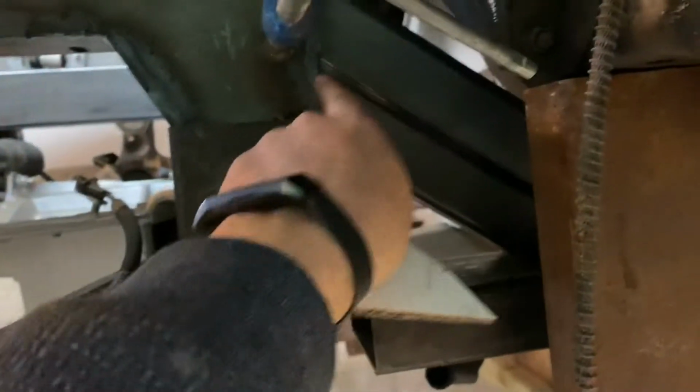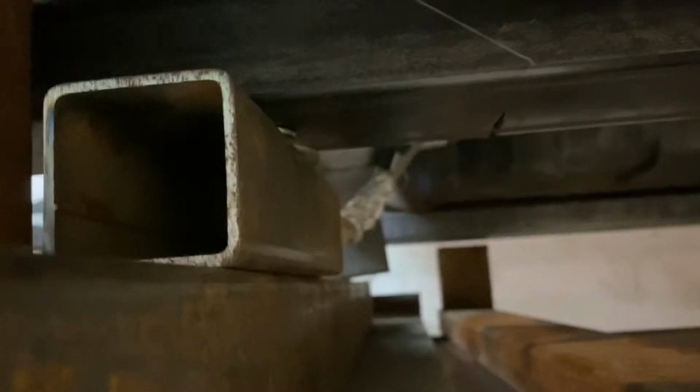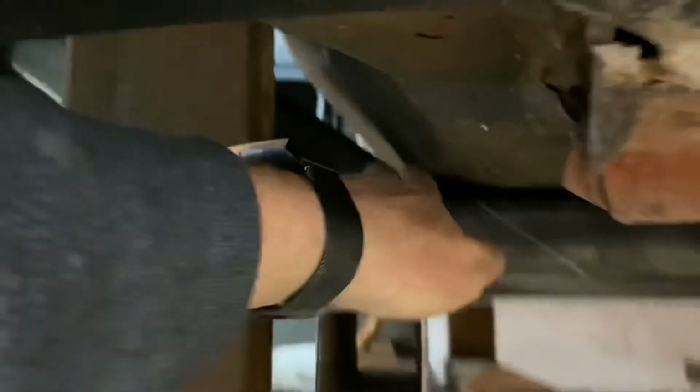Around this side I have the wheel off now, so you can see in here a little better. Here's where we come down here. This rail pockets right into here and it continues down to the bottom, and then you can see I've cut a slot there, and there's also one at the front. This upper rail meets the bottom and that'll get welded across that flange, so it gives it a little more support. Back here, so I welded a tube in there. There's the bolt.